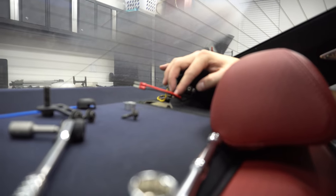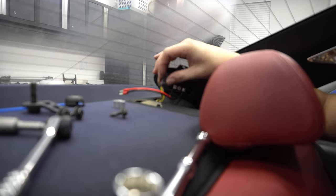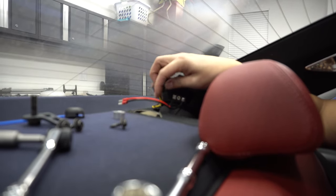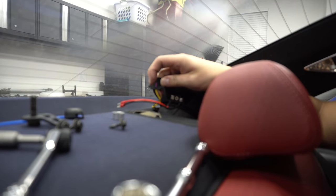Just want to note here on the other side, the wiring from the factory harness is actually brown and yellow. The way this is connected, yellow is going to match with the Bob Sound red. So yellow and red, and brown and black.